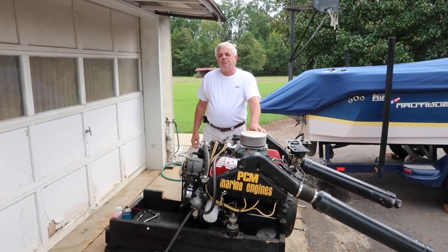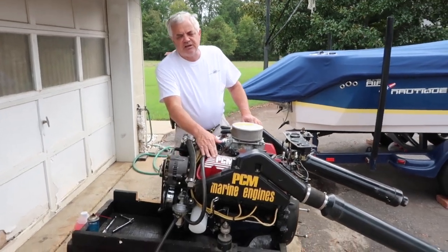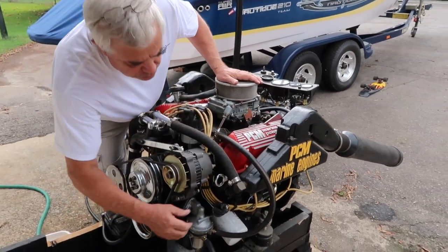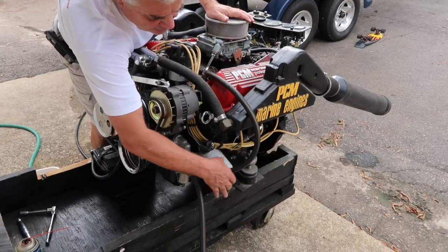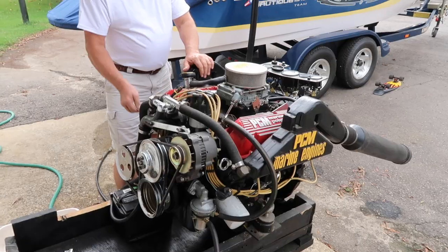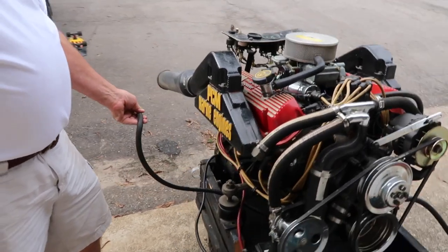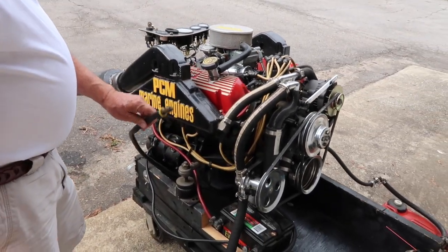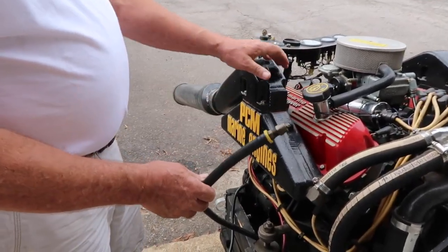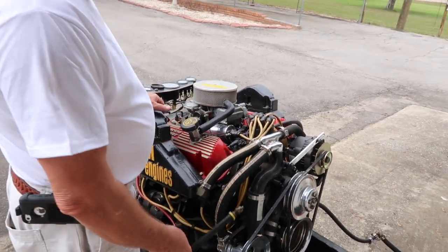On some of the newer GM engines, you'll have a remote oil filter — it's right up on top of the engine, very easy to find and easy to change. On this particular engine, it's going to be in the usual place, which is right here by the fuel pump. You also have an oil drain hose which comes off of the oil pan and goes through the hole on a direct drive. You can also hook this up to a suction pump if it's a V-drive, or you may have to extend the hose to reach the drain in the back of the V-drive boat.